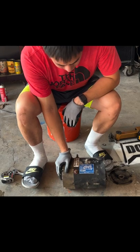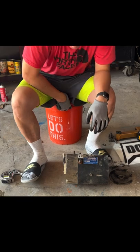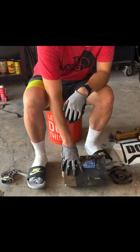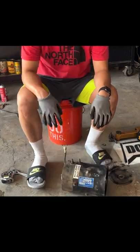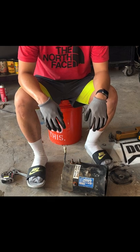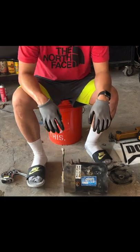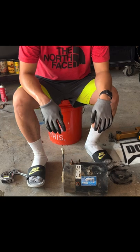I've been told by some golf cart distributors that these aren't the best motors. I've checked everything on my golf cart and cannot figure out why. I've kind of redone the batteries with some Epsom salt, getting 50 volts. Checked all the controller ends, checked with the multimeter again. Getting volts to the motor itself, but it's not going anywhere.